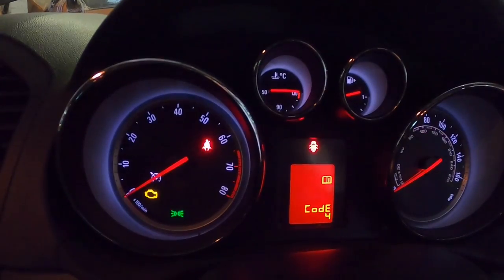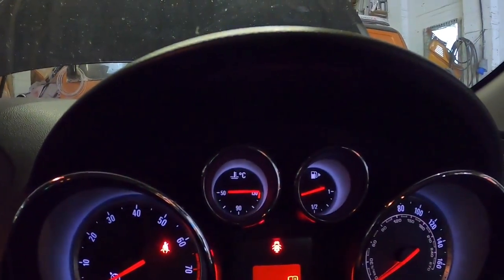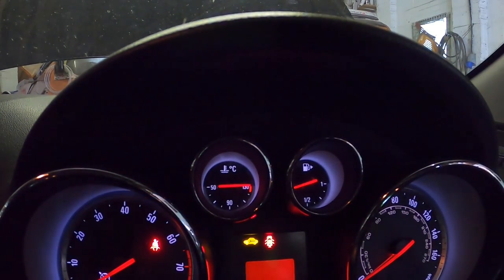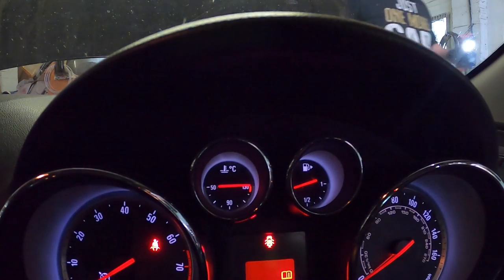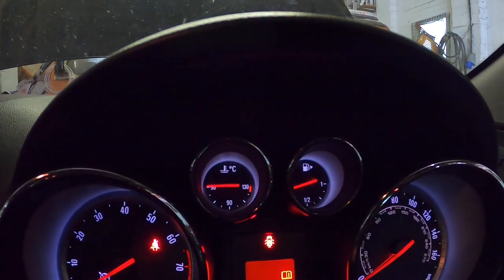So what I'm going to try and do is see if I can set this up now. So it's how I want it to be set up, like that. Now I'm going to go outside and I'm going to unplug it and open it. Let's have a look. Here we go. Going to unplug it now. Theoretically, as I unplug that, the temperature, there it goes. Do you see that? I've just unplugged it, and now it's gone all the way back down to zero. So that now tells me that that is the sensor that is playing up.